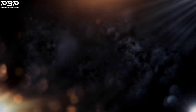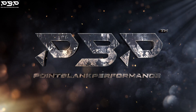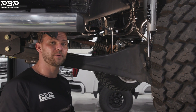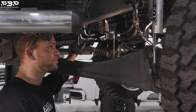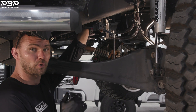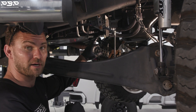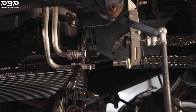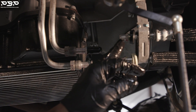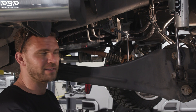First, let's verify you're working on a 68RFE transmission. This is the transmission pan. We're on the passenger side of the truck — you can look through the fender wheel and there will be a block of aluminum here. This connects the lines that hold transmission fluid. The fluid should be red — bright, pretty red.